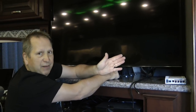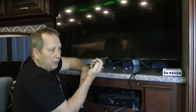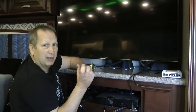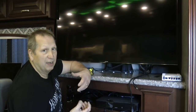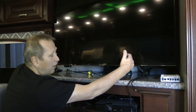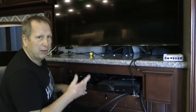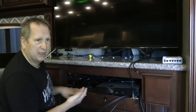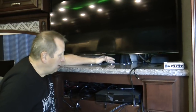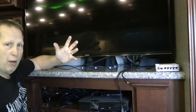So when the TV's loose, you just need to swivel it a bit, enough to get your hand there and undo the RF cable. When I take this telly out, I'm going to actually extend that cable, because it's just ridiculous, the fact that there's no play. All I can imagine is that they wired it up first and then pulled the wires through into here. So just be aware of that, because if you damage the RF card, you won't receive any TV, and you'll need a new TV. Now, when you remove this TV, it's on one big bracket that's got 1, 2, 3, 4, 5, 6, 12 screws.